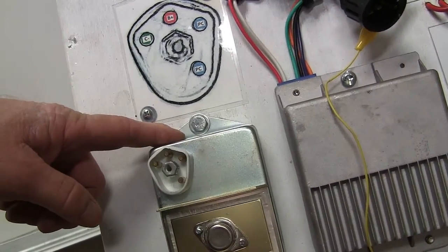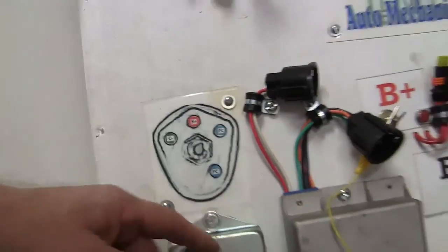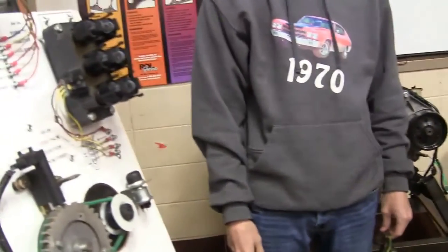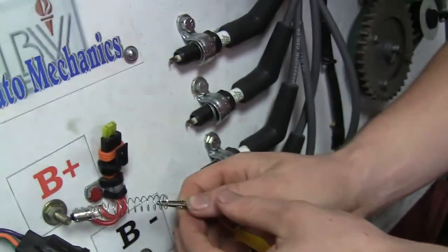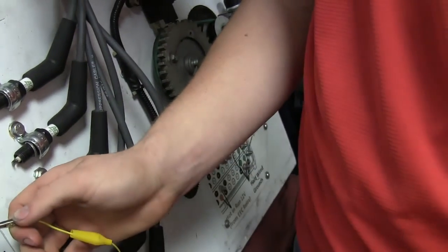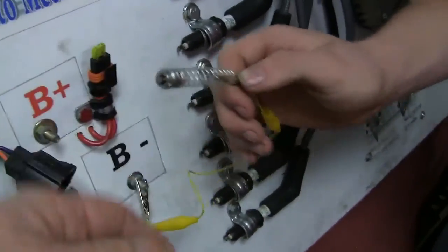Is the bulb working? The bulb's bad? Okay, that was really fast. Now bring the bulb over here and let's test it. How are you going to test the bulb? Hook this to the spring. Let's touch the tip of that bulb right there to this terminal. Look at there — we got a bulb that works. There's nothing wrong with that bulb. Keep working — see if it's the cord. Don't condemn the bulb. That's like saying the car's out of gas because it won't start.